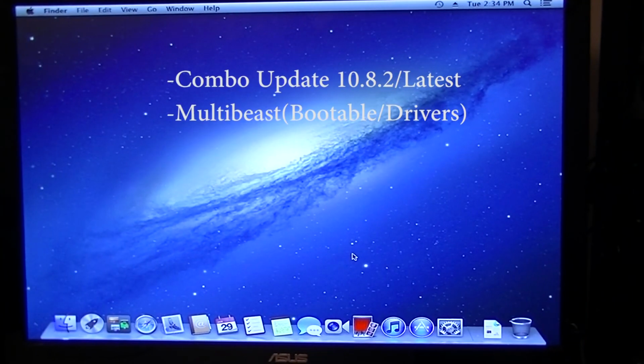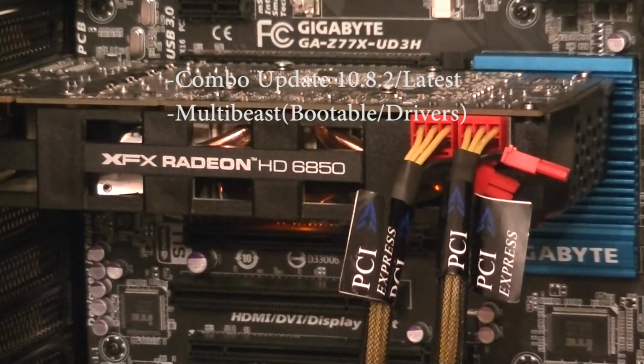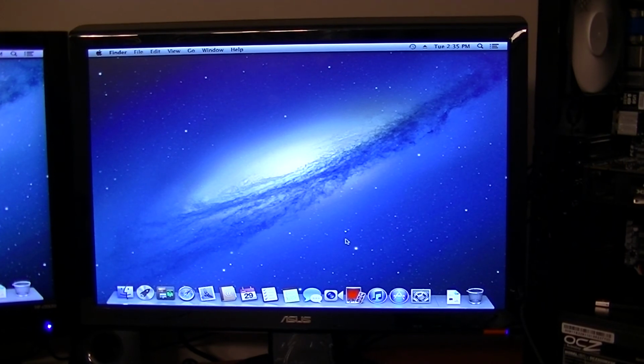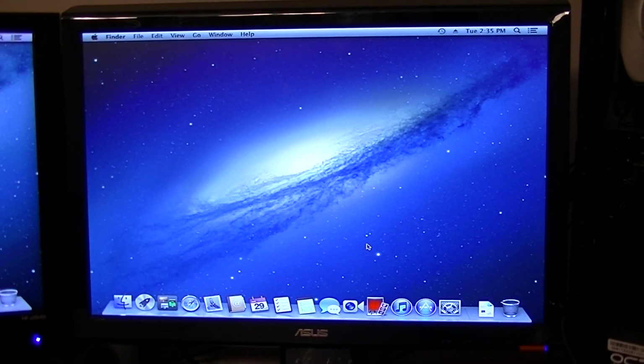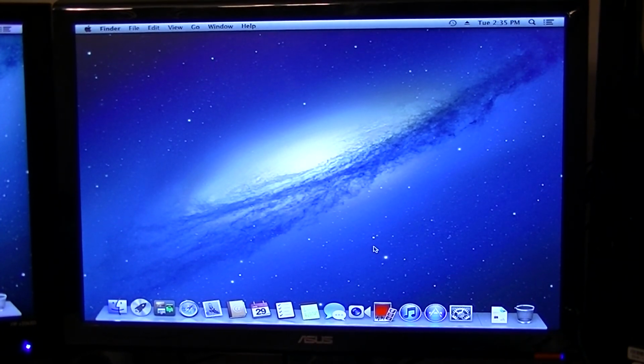From here you can run the combo update, which is pretty basic. For me, I can do my 6000 series, just basically do KextBeast, and run the ATI 6000 kext that we deleted. That's the one you run. You can either download that, or we have the copy of it. You can do that as well.